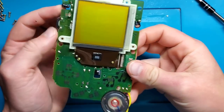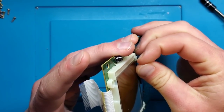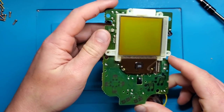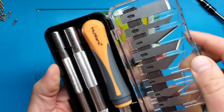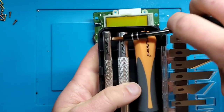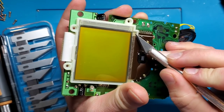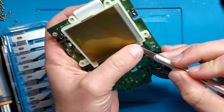This is what we're going to be looking at for the rest of the board. One thing you need to remove is this little rubber pad right at the bottom of the display — just pull it up and set it to the side. There is also a little strip of adhesive here. If you have some sort of small hobby knife, that will work great. Very carefully get the edge of it up and then peel it off. Make special care not to rip this ribbon connector.